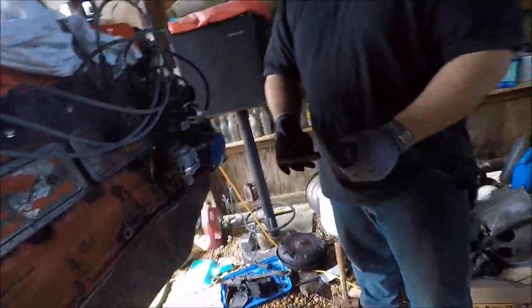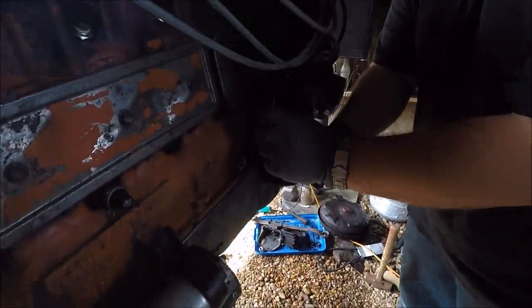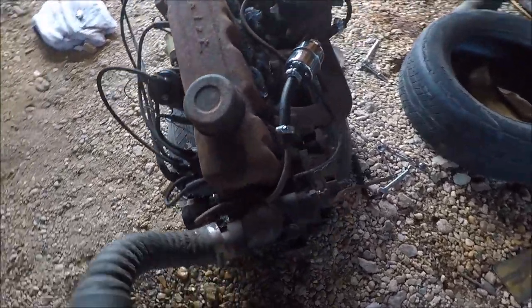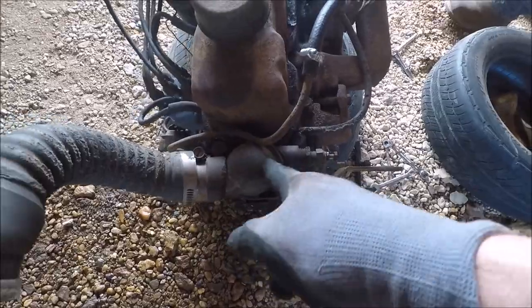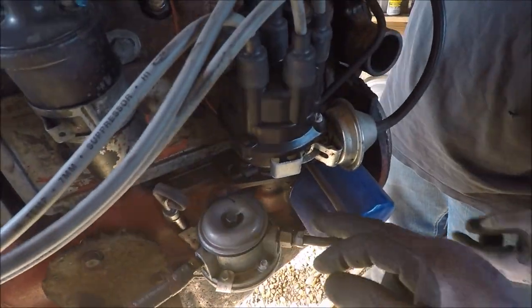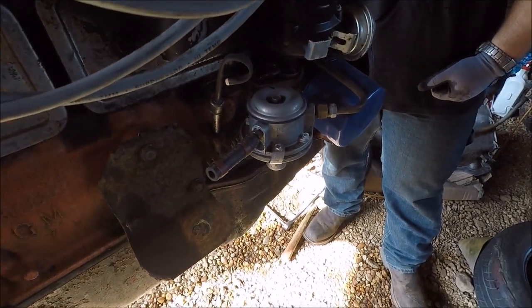It's like surgery — be careful. We need to plug all this. This one has a plug in it, so this plug needs to come out and this whole thing needs to flip around on that one because it's different. This one does not have an inline fuel filter anywhere — it goes straight from the pump to the carb — but it looks like you can put one right here. It's convenient to have it up there; we could do both. So we're going to flip this around.